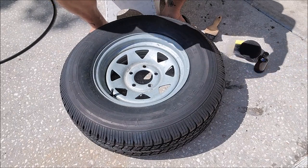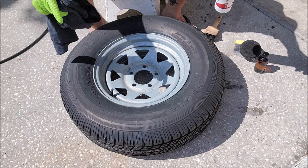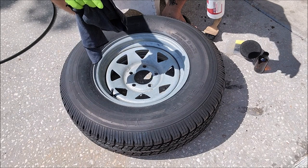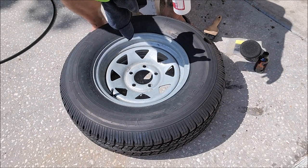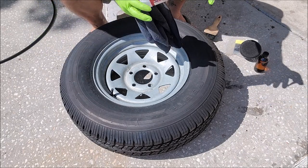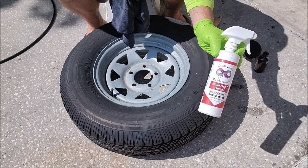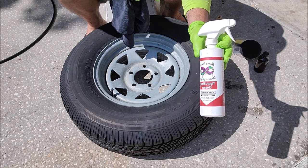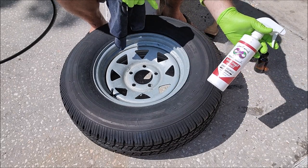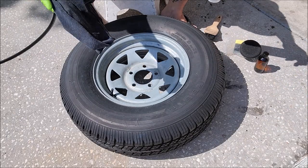The first thing I want to say about applying Infinity Porous Surface on rubber is that water is the absolute enemy. Any residual water is going to make the product turn milky white, and it will dilute the formula where it will chip and flake. What you want to do is take some Tiger's Blood — I've mixed this up one to seven: there are two ounces of the concentrate in here, filled up with water. Two ounces of product concentrate, 14 ounces of water, in a 16-ounce bottle.